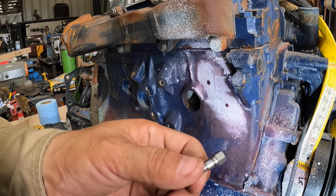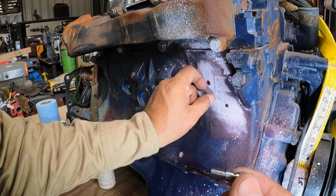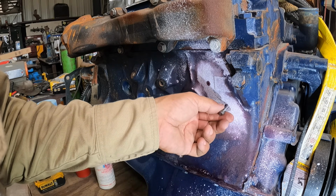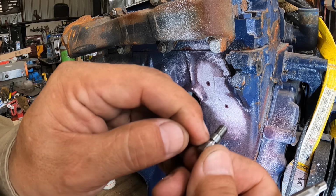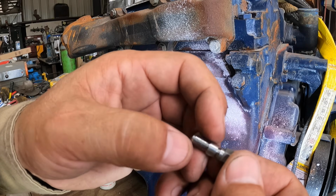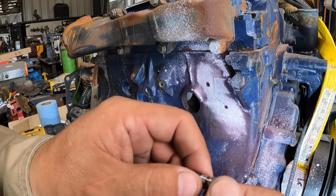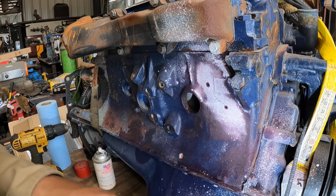So being as how this is not a straight line, they normally have a fixture so that you can have evenly spaced screws and they overlap them. But in this case, since it's a curved line, you have to do it all by hand. And so once I put this first one in and break it off and sand it down a little bit, then I would drill right up against this edge here, the neck of this one, and it'll overlap this screw. This screw is not so hard that you can't drill. It's soft enough to where you can, and they're supposed to overlap so that they create a sealing surface against each other all the way throughout the length of the crack. So really neat setup, and I'm looking forward to using it. So let's drill that hole and get started.